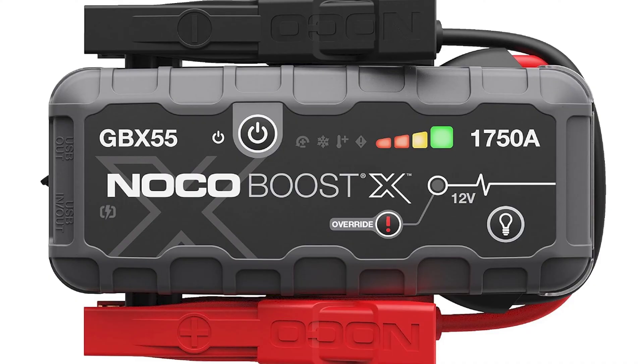Quick video today on the repair of my Noco Boost GBX55 — a booster pack used to start vehicles when they're down, a very handy device to have. I've had it for about six months. I left it plugged into my cigarette lighter to charge it, and basically the voltage has reduced to a point where the internal electronics just won't recognize that there's a battery in there to charge, so it doesn't kick in the charger to bring it back up. Do not take my advice as from a professional because I am not — this is purely let's see if we can get it fixed.